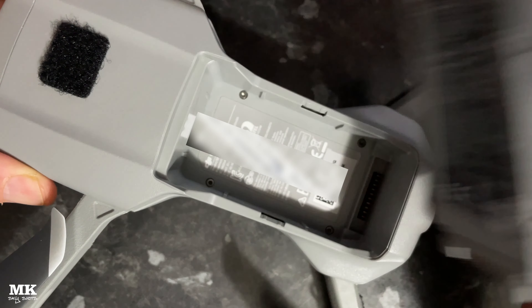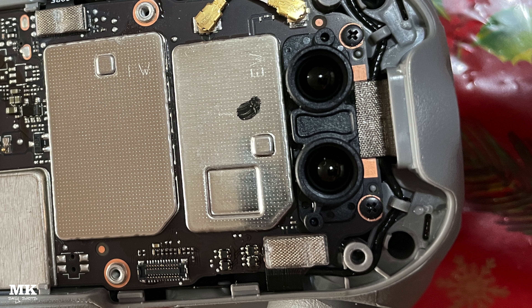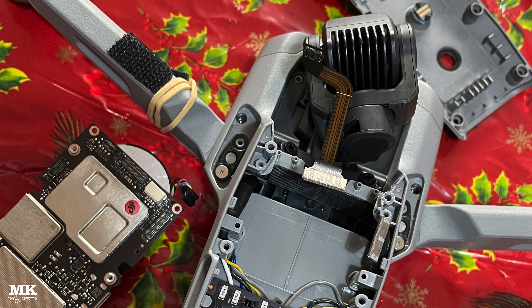This is really important. Once you find your drone in water, don't try turning it on by the button. Just whip that battery out — stop that circuit from running. These drones are full of sensors; there are three circuit boards. Once you get water in it, it's an absolute nightmare. It's important that you strip it down as quick as you can and start drying it off.